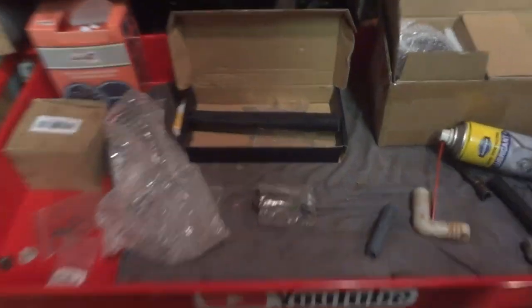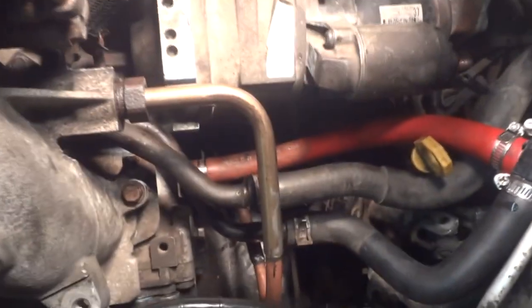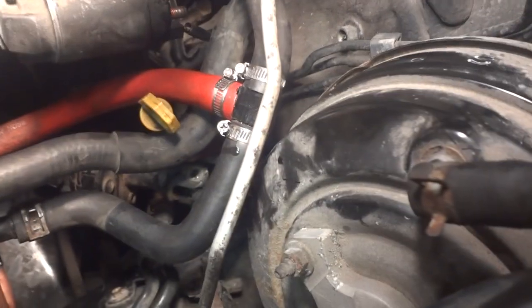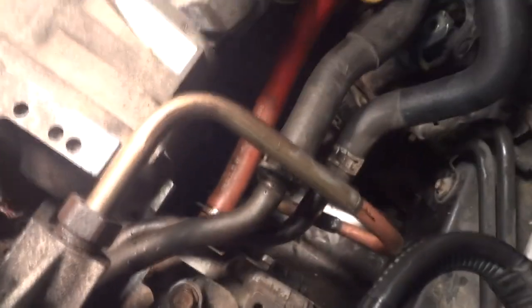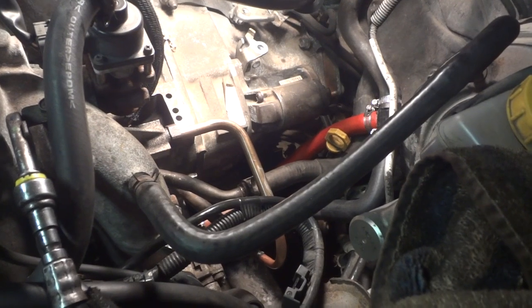We're going to get some hoses on, put that T in the line up here, and come back and see how everything worked out. Now I did get this tight on the bottom — you get a little thumb wrench and it's kind of tough to get down there, but get it as tight as you can. Snug it really good before you make this line because you can still bend it. Tighten it up before you put all this back in. Now as we look at the box here it's almost empty except for this hose — I didn't like that one, a little too short. And now we can come over here and look straight down at it, and boom, it's done. I put a red hose on the bottom there so I can kind of know — or if anybody else buys it down the road — what that is. It goes straight out of the block right up to that heater core hose. All my clamps are on. You see the T right there. The EGR valve is routed around on the back side and going underneath. You can see where that hose comes out there where the EGR tube goes underneath. That worked out pretty good. All I've got to do is hook my starter wire and ground back up, put some fluid in it, and drive it a day or so to check for leaks.